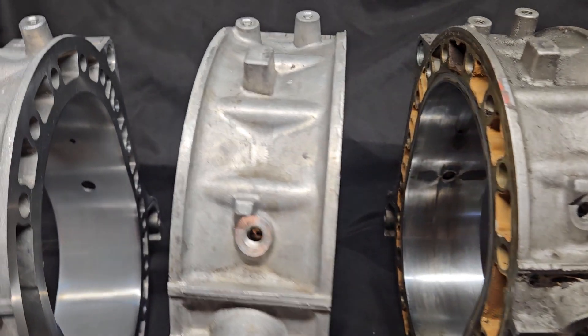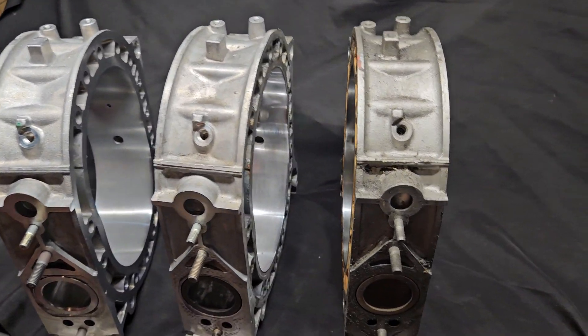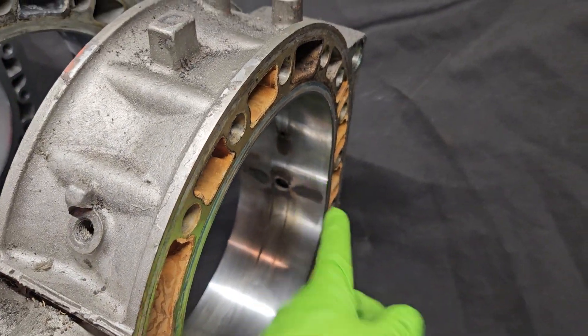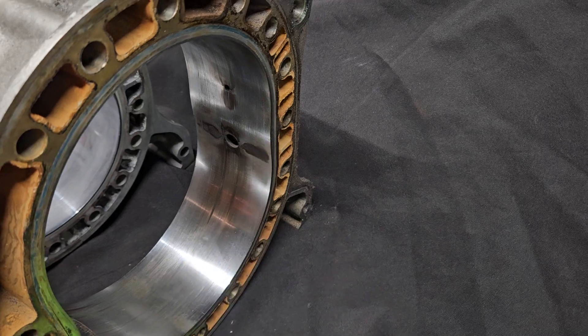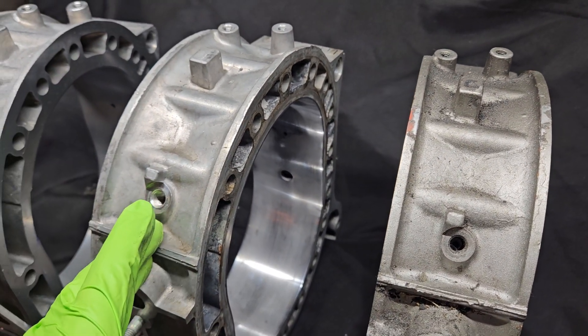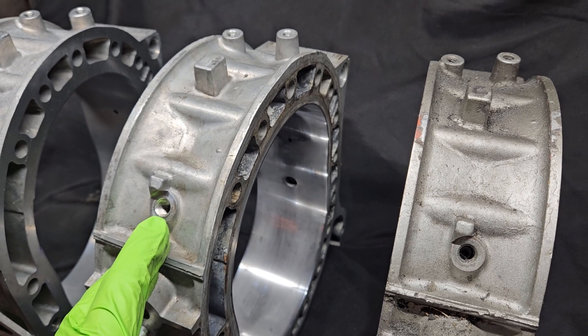Take all of that into consideration. I know everybody's on a budget and we all have to work within our means, but there's no reason to use rotor housings that are beyond their lifespan — corrosion-wise, shrunk-wise, or with cracks or chips. There are a lot of good opportunities out there to find some good housings. I hope everybody keeps on brapping, because that's a brap.